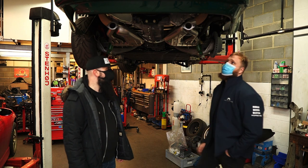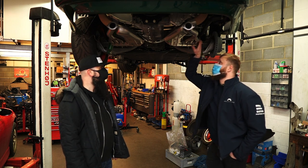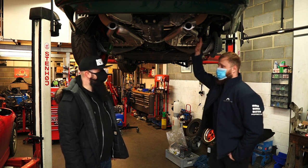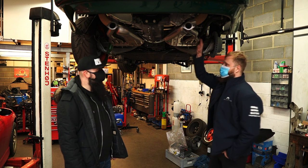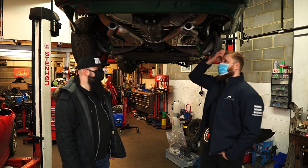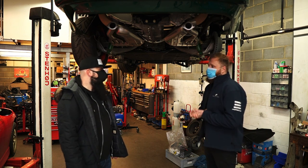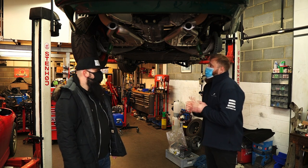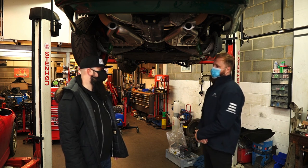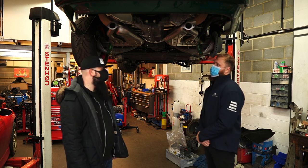Another point that's slightly different: the later cars don't suffer too much with loom problems, but the earlier cars can, because the wiring is more exposed and it's earlier-type wiring. You can have problems with lights and small issues going to the bumper loom and things. You should be having your lights checked anyway, but we do see more problems with corrosion in light units, in terminals, and loom issues on the earlier cars. If it's not a bulb issue, you could have a corrosion issue.